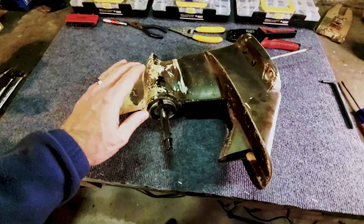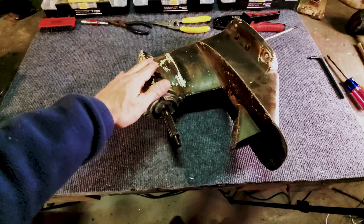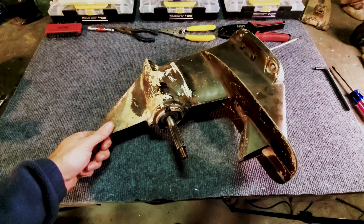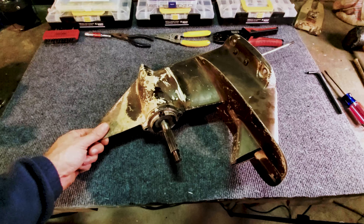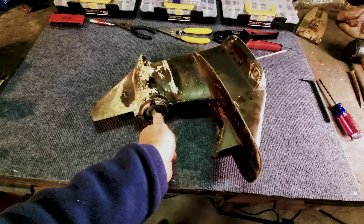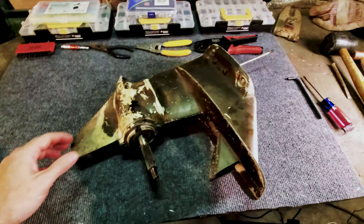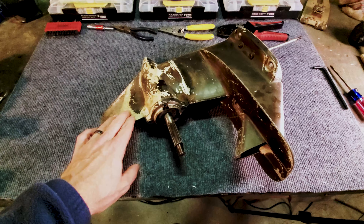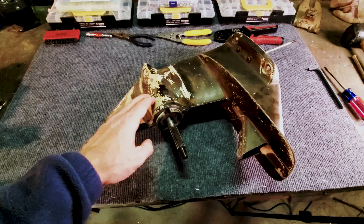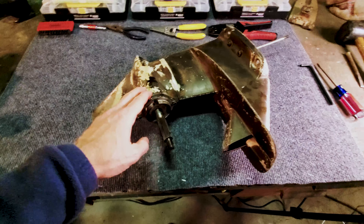Today we need to get our bearing cage off of the prop shaft and take a look at what's inside. I've already previously drained out some of the juicy nastiness that was inside - a good mixture of water and old oil - and there's still some residual that needs to get cleaned out and flushed. The gears all feel really solid, which was very encouraging. I can pull the shift rod and activate reverse and forward and they seem to be working exactly as they're supposed to, so we might be in luck as far as the gear housing condition goes.